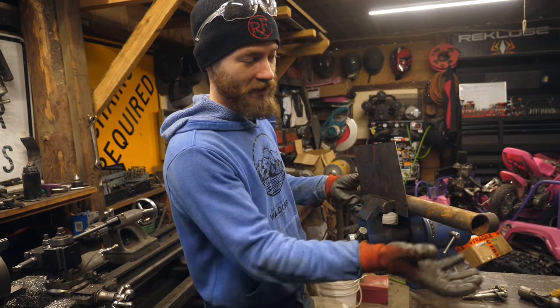This right here is a shiny new intake manifold, which is essentially designed to convert a non-turbo 2J to turbo. We're not necessarily turboing this yet — we want to get it running first. But the bottom line is this intake is way simpler, way smaller, and way prettier than what was on here, so we went ahead and got this now so we don't have to deal with all the crazy stuff that was on the old one.